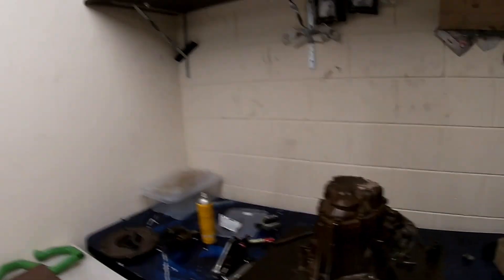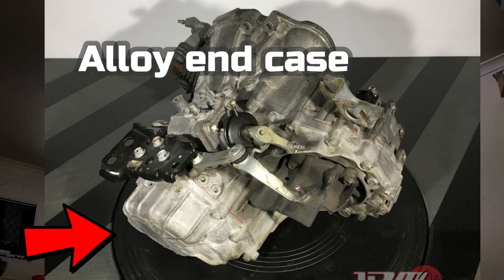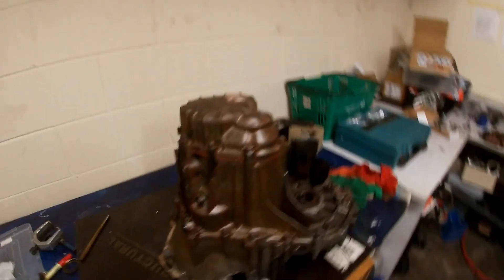But I didn't go into detail about what went wrong with Nick's gearbox. The standard gearbox in Nick's car was originally a C152, which is found in everyday Starlets — we never actually broke that. We thought we'd pull it out and upgrade it with a standard GT C52 while we were there, but it turns out Nick got a bit rough on the gears and managed to break it somehow. The C52s are notorious for breaking third gear, but we don't really know what's gone wrong until we pull it apart, so we'll rip this thing to pieces and check it out inside.